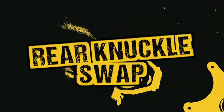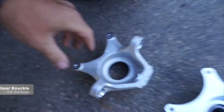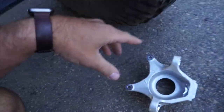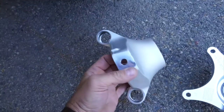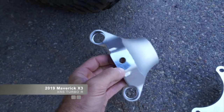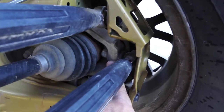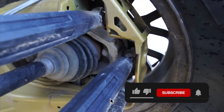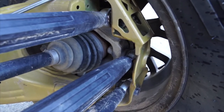Check it out guys — here is the problem. Straight out of the gate, these things are little more than hot garbage, and if you do any sort of hard riding — I don't care if it's desert, sand, whatever — with the horsepower you've got on your Can-Am, you are going to strip out and wallow out this hole right here. This thing is moving like crazy and it'll feel like you're in a boat and somebody's steering you with an oar on the back end. It just wallows itself out, and especially with bigger tires and more aggressive riding, you're going to wear this out faster.